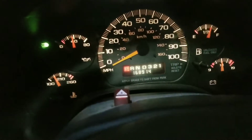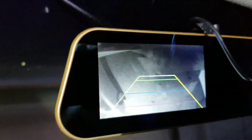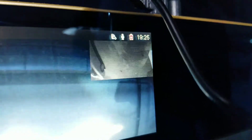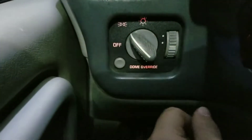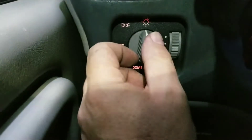It requires 12 volts. For example, if you hit the reverse, your reverse lights will get 12 volts of power, and it's supposed to switch to rear view. That's what it normally looks like — you see the front and a little bit of the back. Because I'm going to drive and I need to see what's behind me all the time, I connect it to parking lights, which is the first click before you hit headlights.